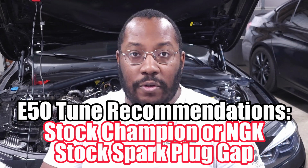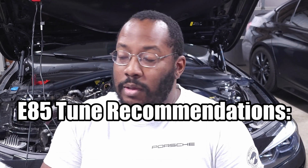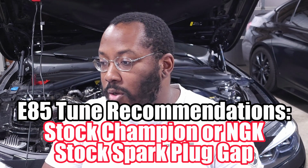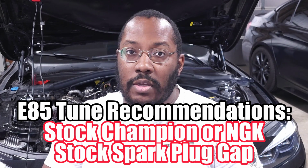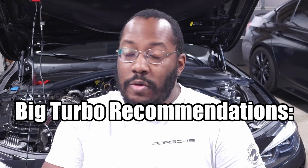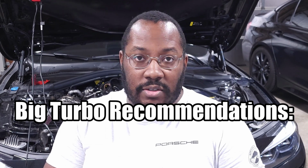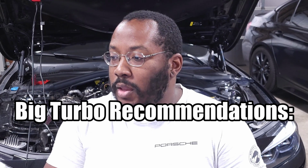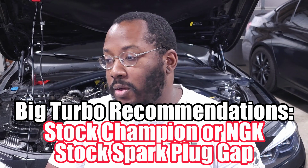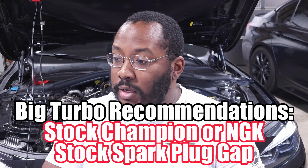Now, if you go all the way up to full E85, that's when things kind of get a little bit dicey. And in that case, I recommend OEM spark plugs. So that's NGK 94201 or Champion 9425 for Gen 1 and NGK 96206 if you have a Gen 2 B58. Now, if you're pushing a big turbo, like in my case, I have a top mount turbo kit. Most of us are pushing 600 to 700 horsepower, so literally doubling the horsepower rating from BMW. In that case, I recommend OEM spark plugs, NGK 94201, Champion 9425 for Gen 1, and NGK 96206 for Gen 2. So hopefully you guys are seeing a trend here.